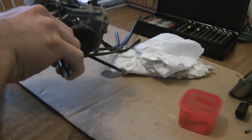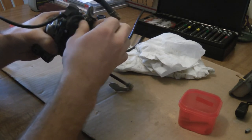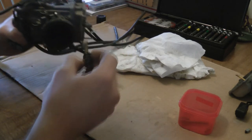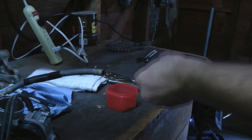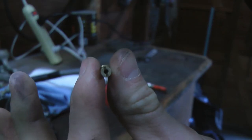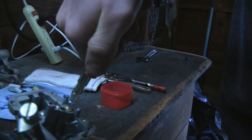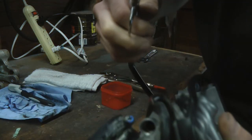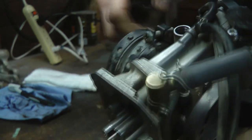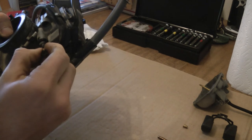I'm going to take the choke plunger here and clean it as well. It operated just fine before I took it apart, but it never hurts to open this up. With every single jet, we just want to blow some air through there — make sure everyone is cleared out. All our jets are clear. Now, on the carb, you want to run through all these where the jets were and blow through. You also want to run through the hot start and choke as well to clear that out.